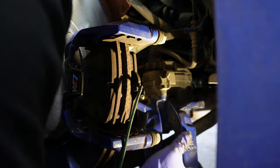And this is also the one that has the brake pad wear sensor. Just going to reference how it's oriented. There is a notch right there, and then you will just click that pad wear sensor in place. You should hear a click once you have it clipped in. Sometimes it could be a little bit stubborn, especially since mine is an aftermarket part, but that's kind of expected since it doesn't cost me an arm and a leg. But now that it's done, you will know, again, this is going to be the inboard one, and the other one that doesn't have the brake pad wear sensor is going to be the outboard.